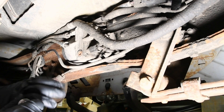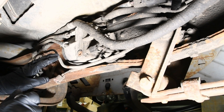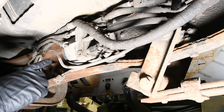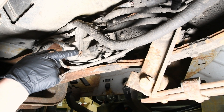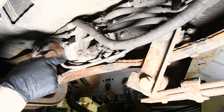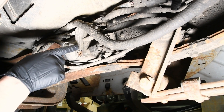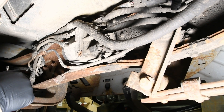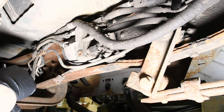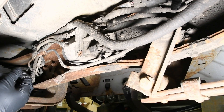It's also a good reason to use high quality fuel filters — cheaper filters often don't separate water properly and all that water goes right into your injectors. On this one the Allen head hole is in good shape, but from overuse and over-tightening the aluminum corroded and the threads themselves are stripped out. So we're going to replace the whole housing and I'll show you the inside — that's what's causing the repeat water-in-fuel light.